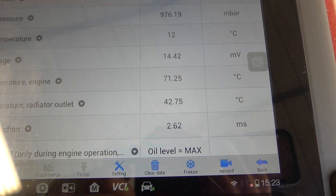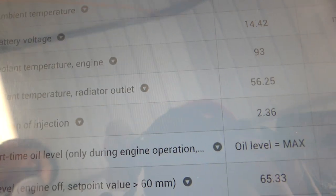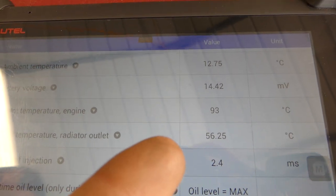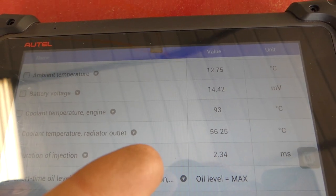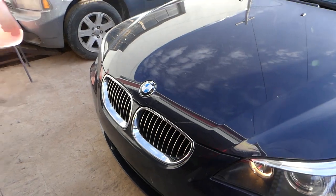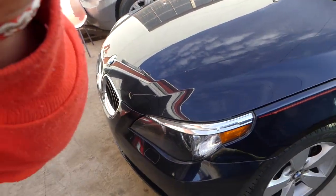The radiator temperature went up to 56 - it was around 30 to 40 before. Coolant temperature is now 93, so the thermostat opened just for a little bit, then closed after that. Everything is good. I recommend cooling the car off now - let it cool for a really long time, probably half a day. Check the coolant level again before you drive it, then you can drive it. Just keep an eye out to make sure you don't overheat it, because it's always a little bit tricky to bleed these systems. Thank you guys for watching - hopefully the video was helpful, don't forget to subscribe!